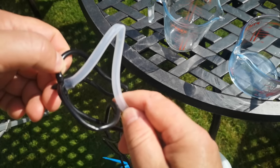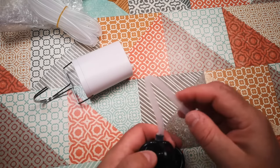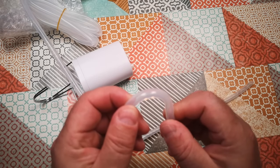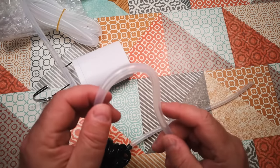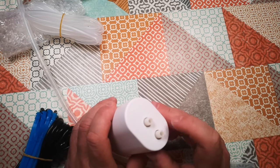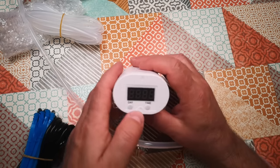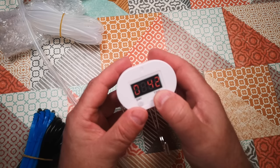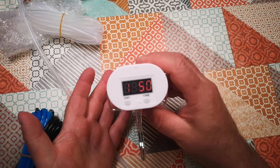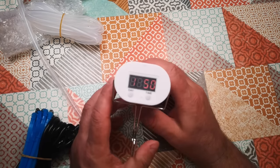This is the pipe they supplied, and as you can see it's just ever so easy for this pipe to get kinked if there's a little bit of a bend in the system. The additional pipe I bought separately doesn't kink nearly so easily when it bends — it does kink if you bend it tightly, but not so prone to kinking just from being bent, obviously because it's got a thicker wall. That kink prevented the outflow from the output valve. The pump ran for a few seconds, then stalled and went quiet. The electronics still work but when I set it to pump it counts down as if it's pumping but there is no sound of the pump.